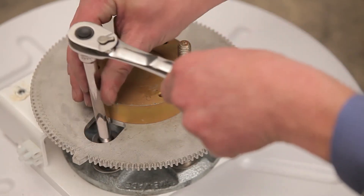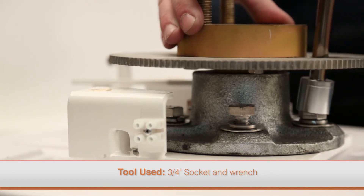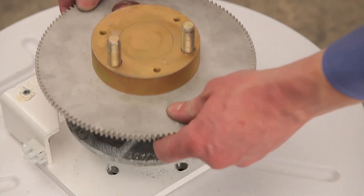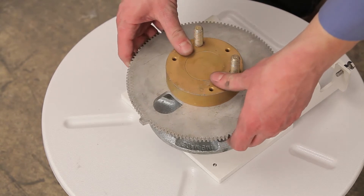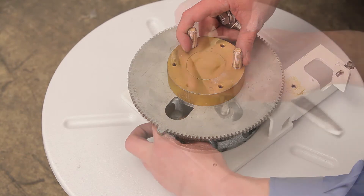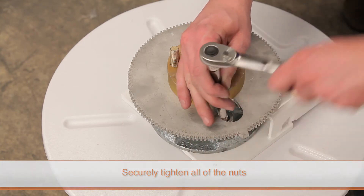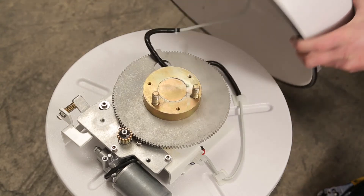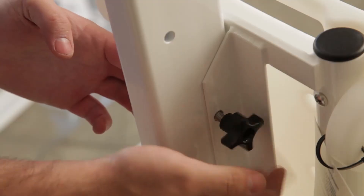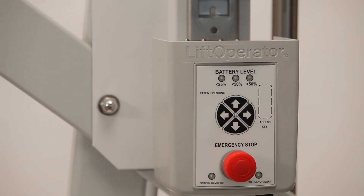To remove the hub assembly on the splash, rotate the large gear so that the opening in the gear aligns with one of the mounting bolts. Using a socket, remove all of the bolts. To replace the hub assembly, insert the hub shaft into the opening in the base and align the holes of the hub with the base. Install the bolts by rotating the large gear so that you can access the bolts and complete the installation. Confirm you have installed all replacement parts and reassembled all motor and gear components properly, then replace the cover on the lift. Replace the mast assembly, reattach the seat assembly, and reconnect all of the cables to the control box, making sure they are plugged in securely, and then reinstall the battery.